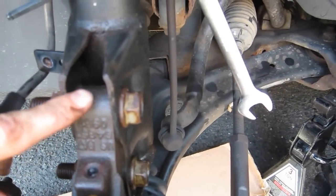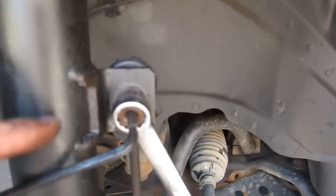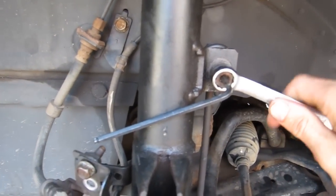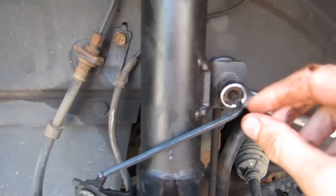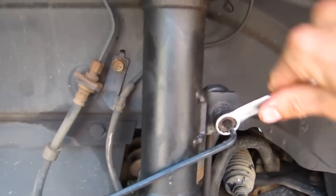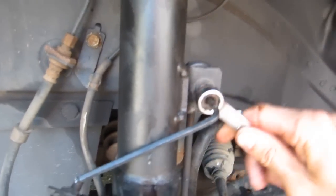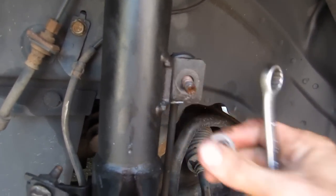You have to get at this bolt and this bolt — the knuckle here is going to stay in place and the whole shock and strut assembly is going to come out. This was giving me the most trouble just now, only because it was rusted. I found you can brace an allen key down here. It's loose now — the allen key will come down and hit there and stop, but you got to be careful not to strip it out. I had to go in and out multiple times, spraying it down with WD-40. Finally it's loose enough — it's going to come off in about two seconds. There goes the allen key, there goes the nut.